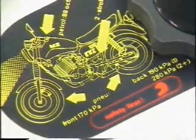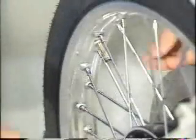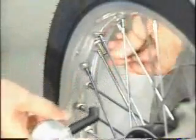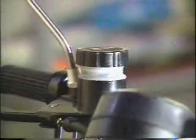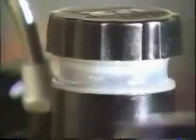The fuel tank sticker contains, among other information, the correct tire pressures. Check the tire pressures by means of a gauge and re-inflate if necessary. Examine the brake fluid level in the master brake cylinder reservoir. Top up if necessary. Carry out a functional test of the brake systems.